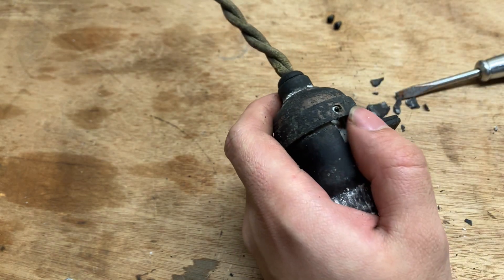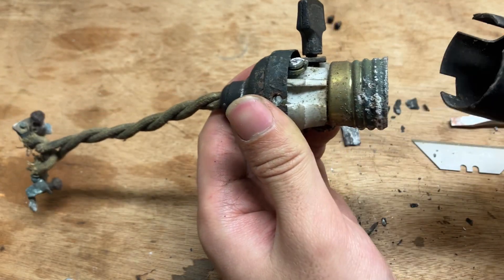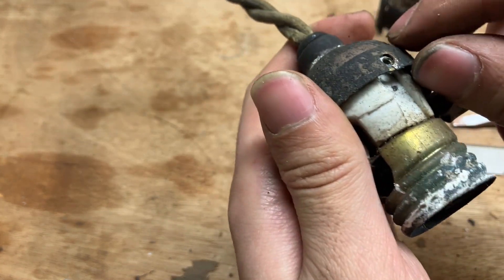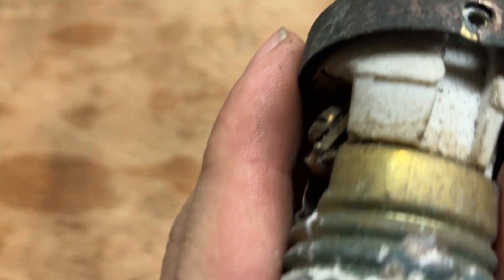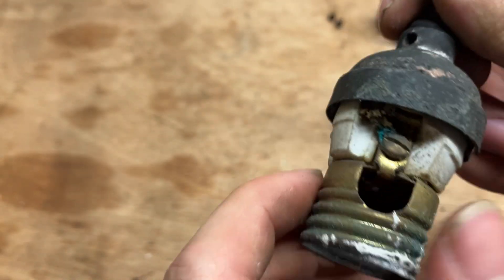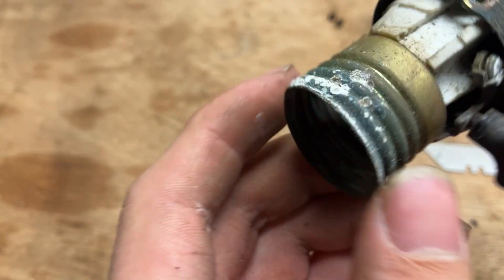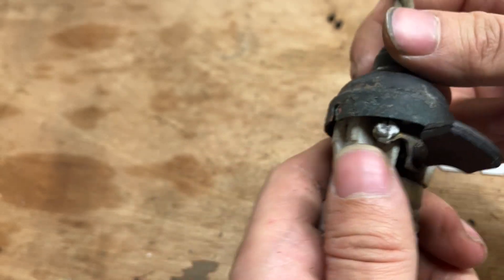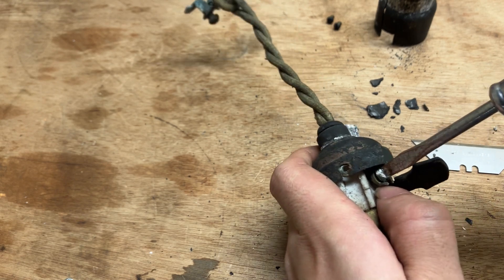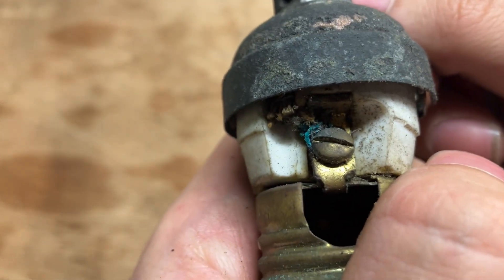Maybe I can make a slit in it — let's see if I have a razor blade. I genuinely apologize for all the jump cuts, but there we go — slid it and it came off. The brass in the upper part is just kind of falling apart; it's turned a coppery color, it's a bit compromised. There's also a crack in it, but I can repair that by bending it back into shape carefully and then putting some solder over it. Let's see if these screws come undone. That didn't take much force at all. Look how crusty those wires are.